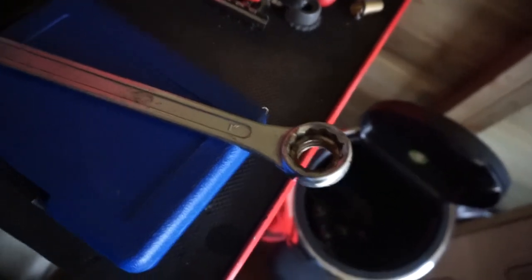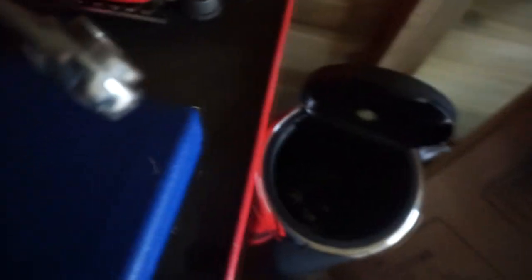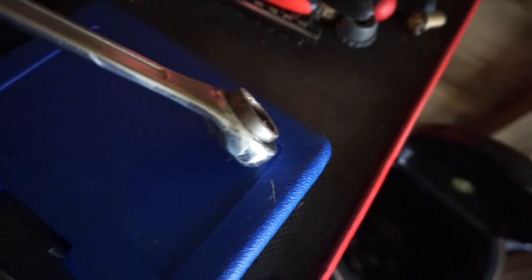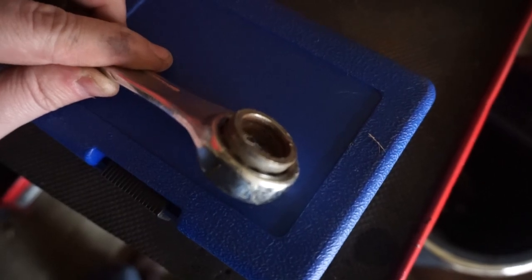So now I've got all four of the locking wheel nuts off. I used a 12-point spanner — I hammered that onto the locking wheel nut. What you see in there is the collar that spins freely. I knocked it over that, and once I did that you want to leave about a 2mm gap between the spanner and the wheel so you don't damage the wheel. I pulled away at the top of the spanner and kept turning it about a quarter of a turn, and eventually it pulled it away slightly — just work on that and eventually it just comes off. There's a circlip that sits in that groove inside, and I think once you're working it, it does break that off anyway, and then the collar comes off. Then you can just hammer that out of the spanner afterwards.